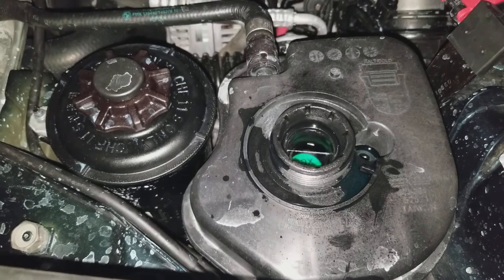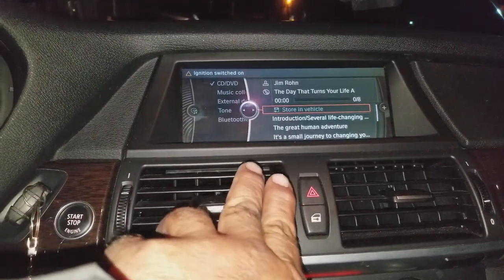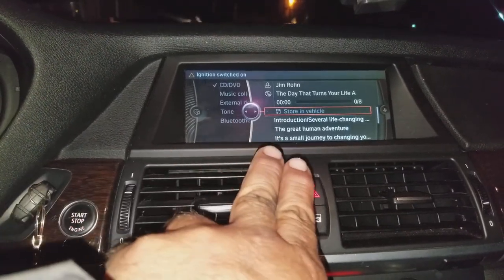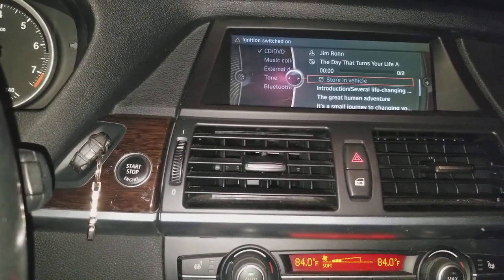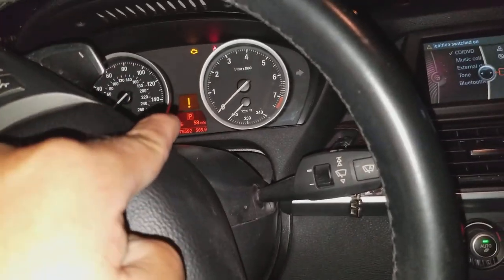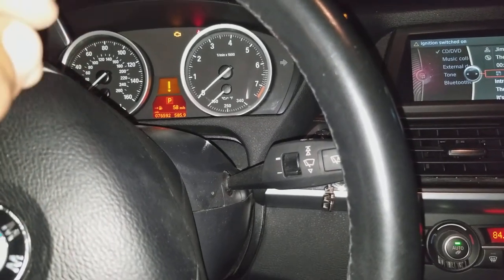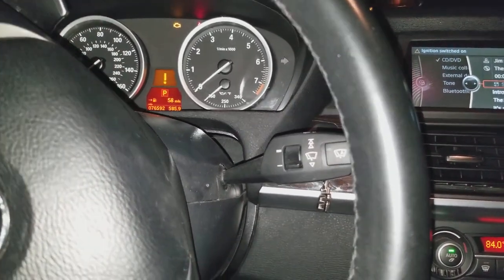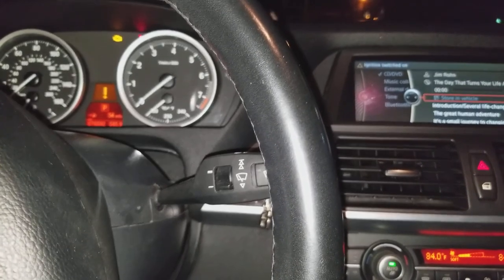For some reason it just wasn't working. Every time we'd take it for a test drive, a warning sign would come on the screen saying something about switching to safety mode — it wouldn't allow the car to go any faster than about 30 miles per hour. The temperature gauge also showed the car getting overheated, and we'd have to park and let it cool down.